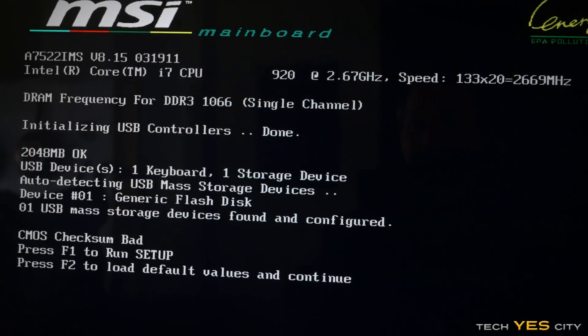We just tried the ECC memory and as you can see here it's working. I'm a little perplexed because I'm positive the memory controller is built onto the chip with Nehalem — they were the first generation. What this means is that the i7 consumer grade actually supports ECC memory, which is cool. I guess it's a dormant feature that was awoken by a BIOS update. Very interesting. I'm not entirely sure of the exact reason, but the ECC memory is working.